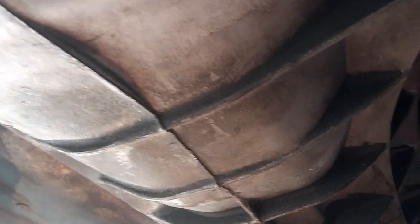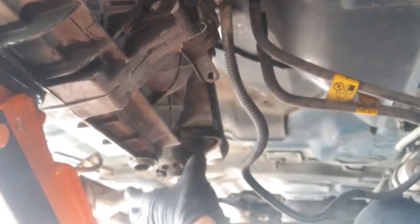Now, it was pushing against one of the spots on the pressure plate, where the clutch release bearing actually sits, it was actually sitting on that. So I had to lift up the transmission from up here and kind of bring down the rear housing a little bit to angle it up. But then at the same time, the top was kind of hitting against the transmission tunnel. But I was able to manage to get it, so I'm just kind of updating on that part, and then we're just gonna go ahead and finish the remaining on that.